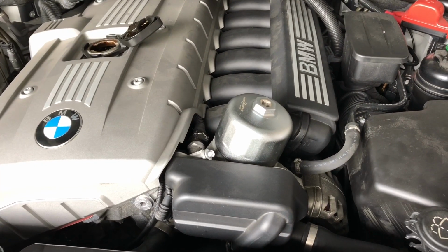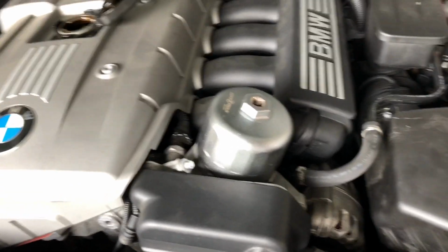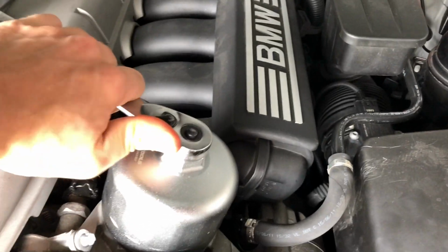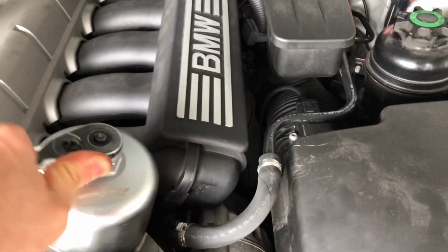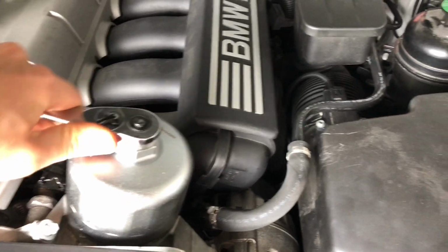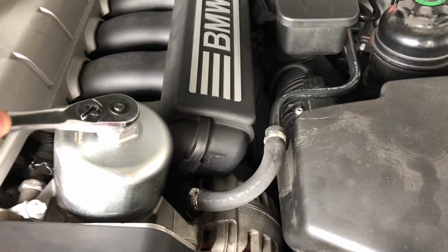So that's still draining down there, it's still open. Figured I'd go ahead and get this off. So you will want a plastic bag to get your filter off, just to put the old one in. And the key I found is just to do this slowly. The first time I did this, I got oil everywhere.